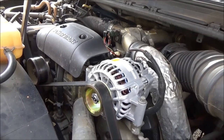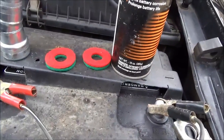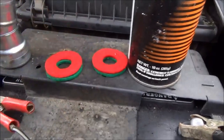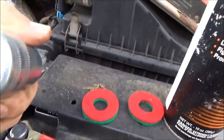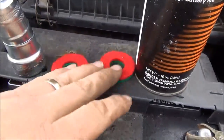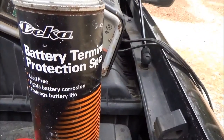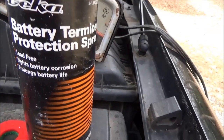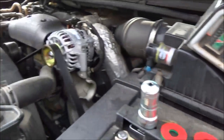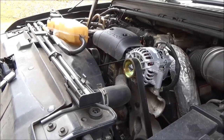I feel pretty confident I could travel three to four hours without the alternator, working off these dual batteries — as long as they're in good shape. Mine were not so well maintained, I'll confess. So I'm going back with cleaning the terminals using a good internal and external battery terminal brush, some anti-corrosion felt pads, and the Deca battery terminal spray that I use on my solar systems. We're just about charged up and the alternator is back in.